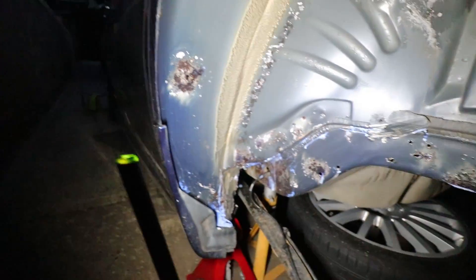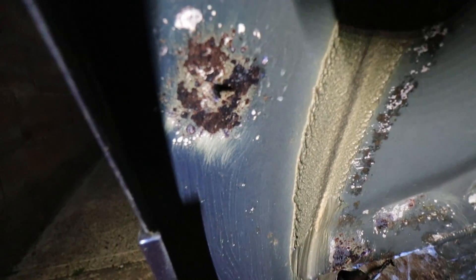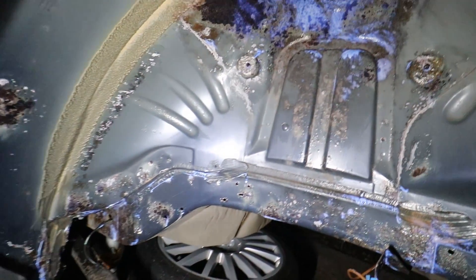It's got dark now - pretty much pitch black out here - but I have vac-tanned both sides. You can see on this one I've covered all the rust I could possibly find and it's turned that dark colour, which is what you want to see. I'm going to leave this overnight and let the vac tan go off. In the morning I'll spray it with either the tough black paint I used on the subframe, or the under seal - I bought six cans. I'm a little dubious about putting under seal straight over rust even after vac tan, so I'll decide in the morning.